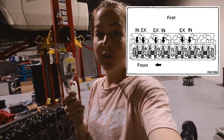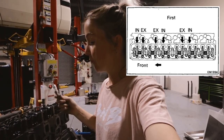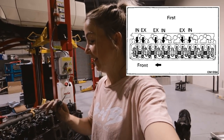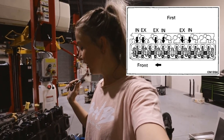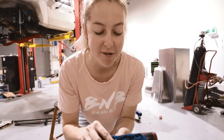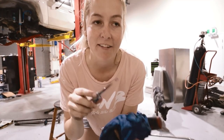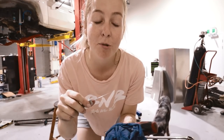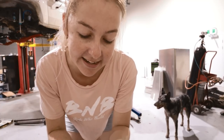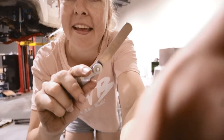So I'll keep my 0.2 out and do all the inlets, then swap over and do the exhausts, then rotate the crank and do all the ones we left out. A few little tips: make sure your feeler gauges are clean, and what I normally do is put in the limit — 0.2 is the limit for the inlets — put it in and tighten it up until I can't move it, and then back it off from there. For exhaust we need a 14 thou or 0.36.